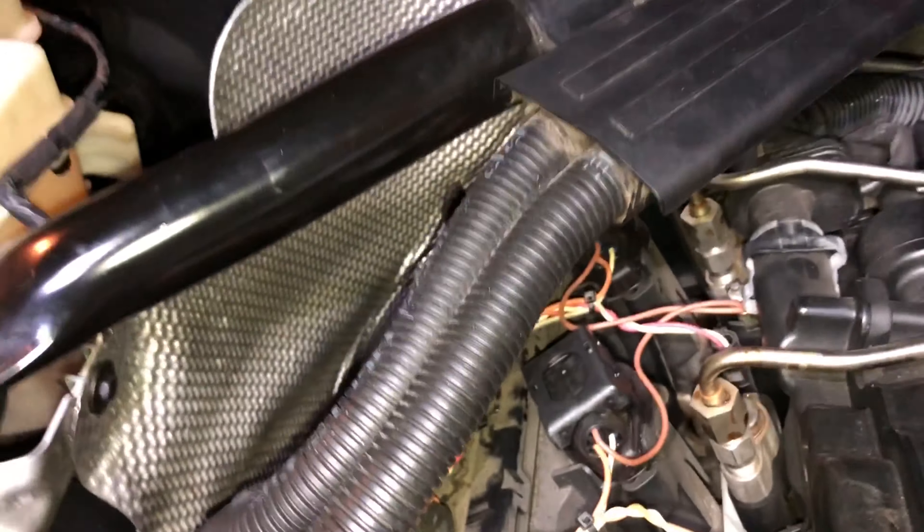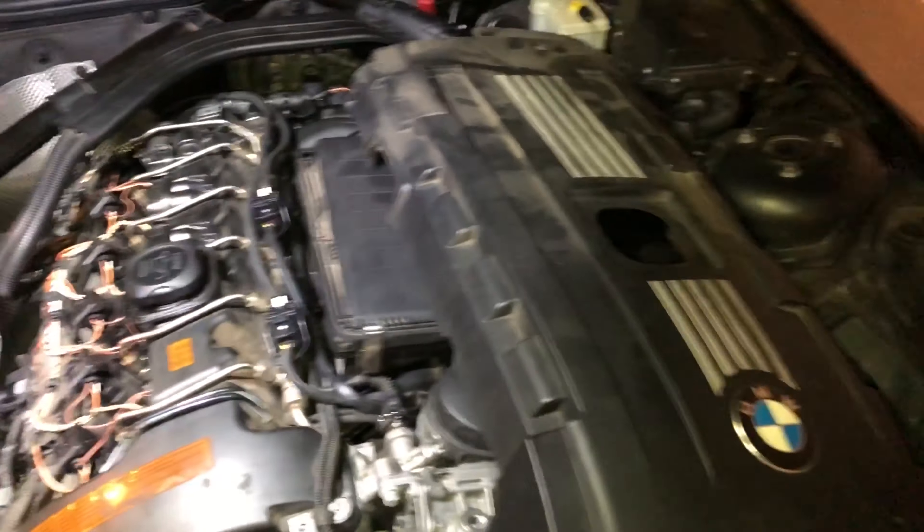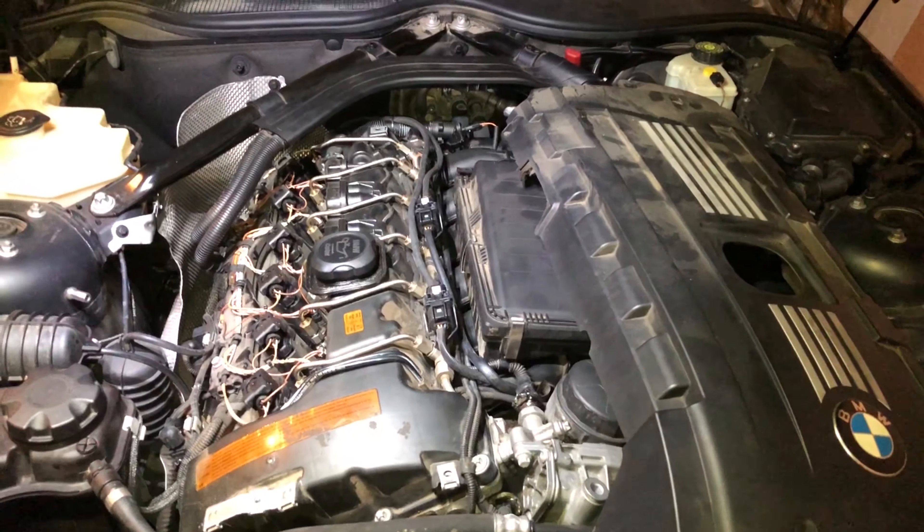One of the things I wanted to point out: they're OEM type stuff. On this old one you can read 'Bosch OEM A1' and here '09 04 30' — I read that in European as being 2009, the year the car was manufactured, April 30th. That's how old this is — it's the original coil pack. This new one reads 'Bosch OEM' and above that '18 05 07,' so this was made in 2018, May 7th — brand new this year. To install it, arrange it facing towards the plug-in, and there's a notch on the side that's going to line up with the slot, so get it aligned.